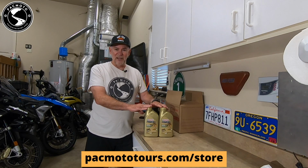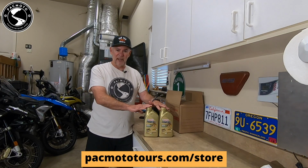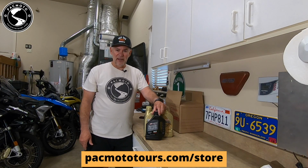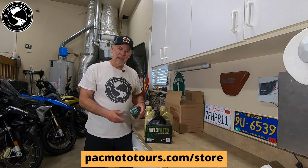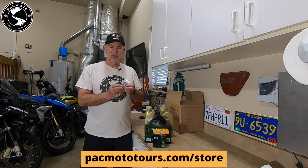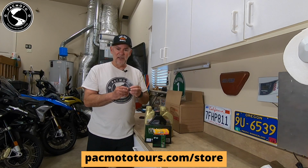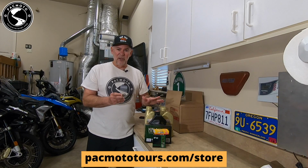You get 4 quarts of Castrol Power1 5W40 motor oil. I should mention everything in this kit meets all of the BMW specifications. So 4 quarts of Castrol motor oil, 1 quart of 75W90 GL5 rated final drive fluid, a 7915 Hiflo Filtro air filter, a Hiflo Filtro HF160 oil filter, and 2 LMAR8 DJ spark plugs, and of course crush rings for your project. So 1 crush ring for the oil change, and then 5 sets of crush rings and O-rings to do 5 final drive changes.